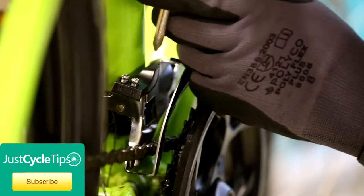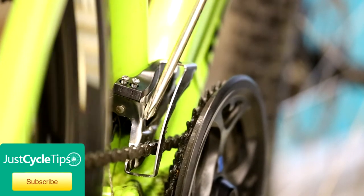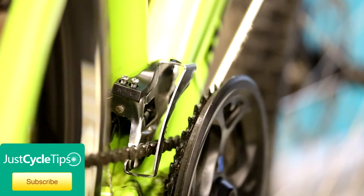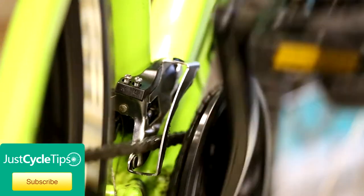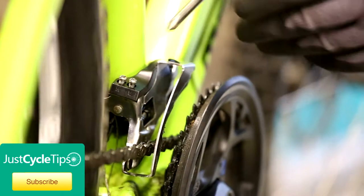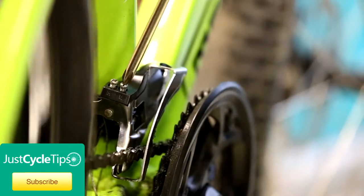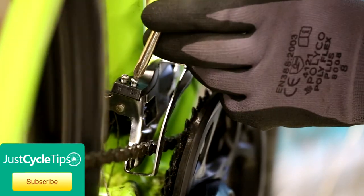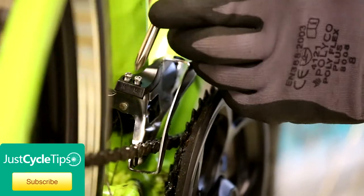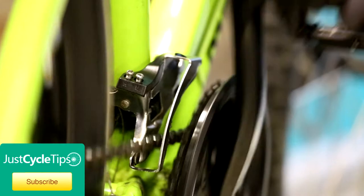At the moment it's fairly close. There's quite a big gap between the chain and this side of the derailleur, so it doesn't rub, but equally there's a possibility it could under shift and you'd be left with the chain scraping against your frame. To prevent that, we're going to tighten this screw — turn it clockwise, which brings the derailleur, you'll see it literally move. We're going to do that until it just starts to rub on the mech and then back it out a tad. Now there's a gap between the front mech and the chain, and that's your lower limit set.